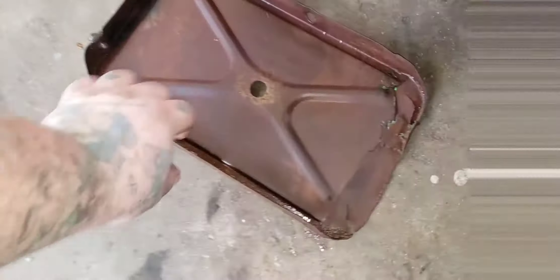As far as the battery tray, I started to weld it up, but unfortunately the part that was still rusted is kind of thin. So what I'm going to do is put a piece of metal behind it, finish welding that up, finish painting it. I also just painted the back side of both of these just to stop them from rusting again — you won't see it, but at least I know they won't rust any further. Then I went ahead and scuffed one up and started to bang out some of the dents — that one was way worse than it is now.